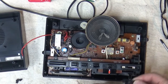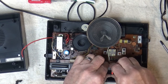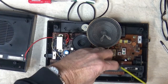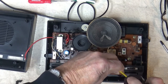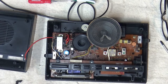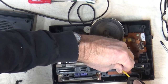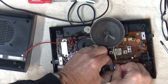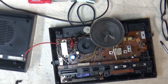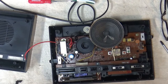Before closing this up, I'm going to go ahead and pop this off. This is the on-off switch — that gives you access to the internal guts of the switch. I'll do the same thing on this one — this is the time switch. I'll just squirt some deoxidizer in there. This one's running out, let me get a new one. Put it in there. Turn the switch a bunch of times. I'll go ahead and put this back together and see how it's working.